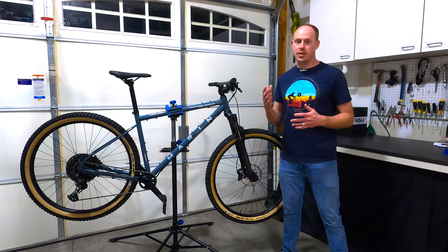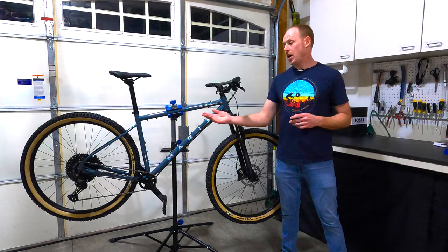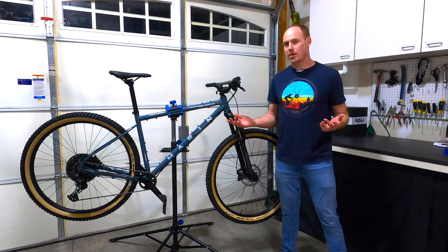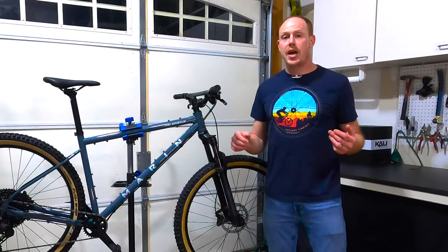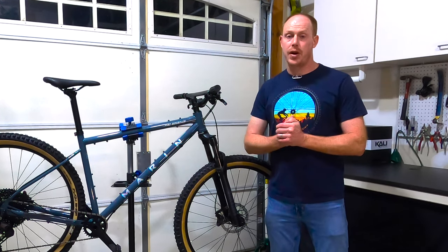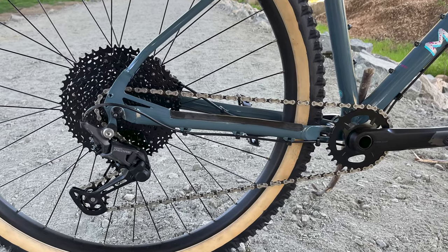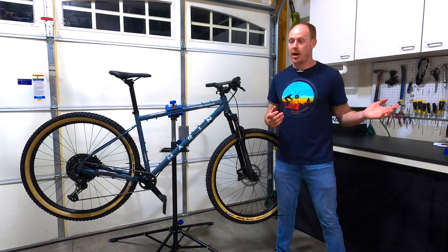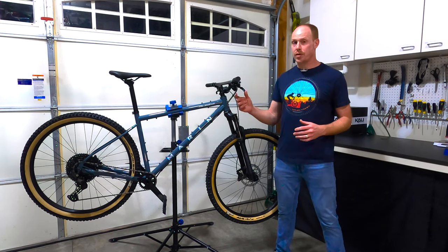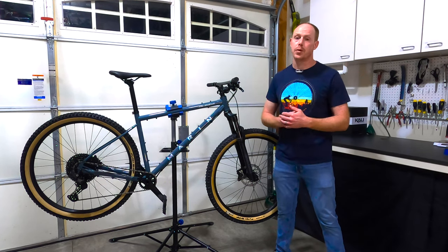The shifter connects to the rest of the drivetrain, which is mostly Shimano Deore 11-speed — Deore 11-speed shifter and Deore 11-speed derailleur. However, they've opted for a Sunrace 11-to-51-tooth cassette, which has the same range as the Shimano equivalent; my guess is they saved a few dollars doing that, and Sunrace is a reputable company. The Shimano Deore derailleur does have a clutch to keep the chain from flopping around, and it works just as it should. The shifter action feels notably lighter than anything I've used before.